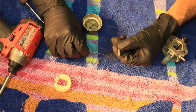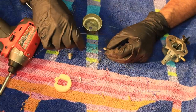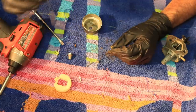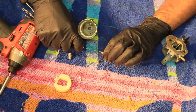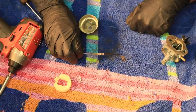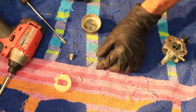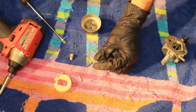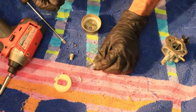Just run them through each hole just like that, and of course don't forget to go down through the middle. Not too likely something will be in the middle but might as well get it while you're here. For this little jet, do the same thing — start off with a small one.